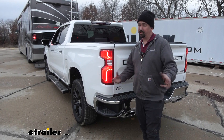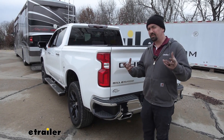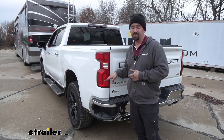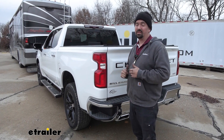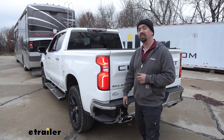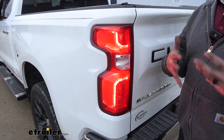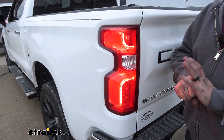When it comes to flat towing a vehicle it's much like a trailer, and a trailer has lights to let people know what you're doing. This is going to be behind your RV and a lot of times you've seen those magnetic lights on towed vehicles, but that means you're going to have to store those and run your cable all the way up to the RV. The new way to do that is diodes — they simply attach into the factory taillight signals and you run diode wiring up to the front to a six-pole, which is going to transmit the light signals via the umbilical from the RV. So when you have your running lights, turn signals, or brake lights, it's going to transmit them to your taillights. The diode wiring is safe and it's not going to cause any damage to your factory vehicle wiring long term, and once it's installed all you have to do is hook up your umbilical and it's ready to go.